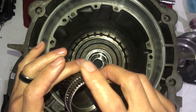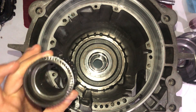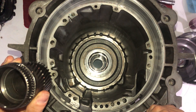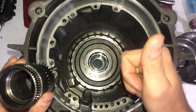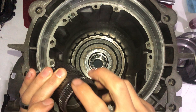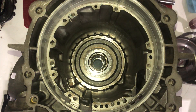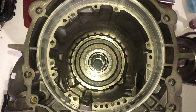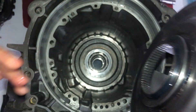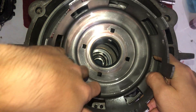Alright, back to assembly. Step one: take the sun gear, inspect it, make sure the bushings are good — you'll probably want to replace the bushings. I replaced all the bushings since I had it torn apart. Take the sun gear, put it into the rear planetary assembly, make sure it moves freely. Then you're going to put the bearing on there with some assembly lube to hold it. If you have the normal style, you'll just put the plastic thrust washer down there and put the case on.